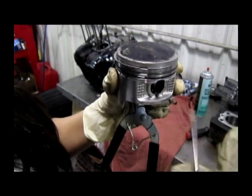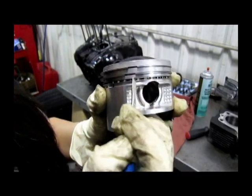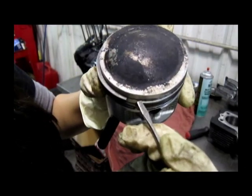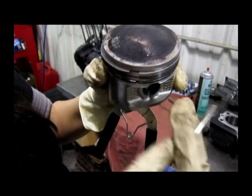I'm going to show you the different parts of the piston. You have these two rings, which are compression rings, and there are three rings down here sandwiched together, which are the oil rings. At the top of the ring you can see a little end mark here and here, and that's just to tell you which side is facing up when you put it back together.